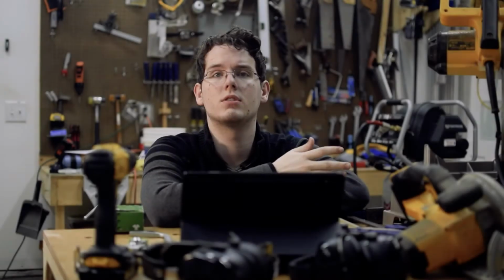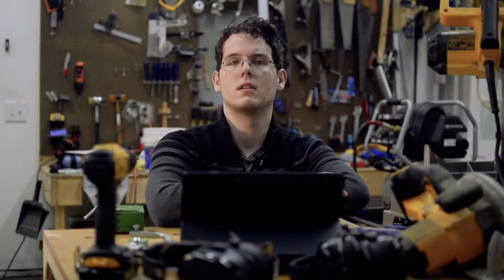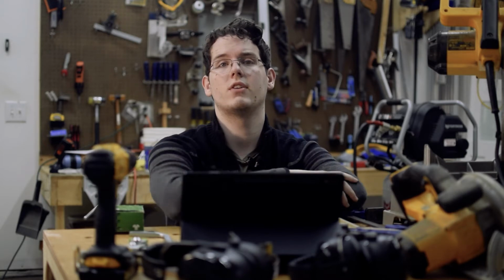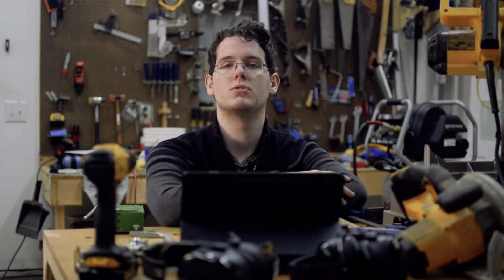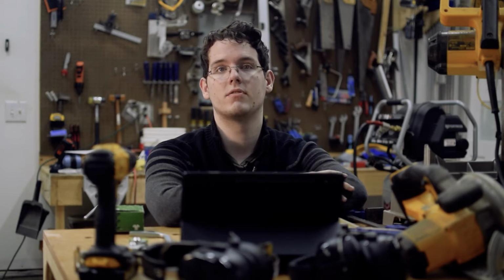I wanted to talk about some of the safety before you start leak sealing. You're going to want to use an organic vapor respirator to protect yourself. This leak seal is very not healthy. It's very bad for you. It's got a very strong chemical and smell presence, and you're going to want to use a respirator to protect yourself from that, and a highly ventilated environment.